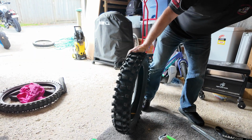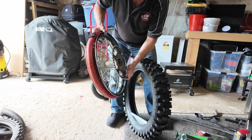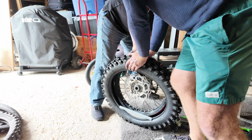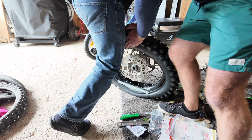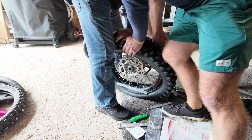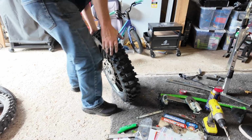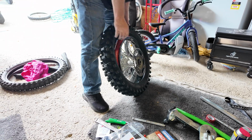You got a metal plate there. Put a little hand here for a second. So what we need to do is press down on there to make the tyre quite oval. And it will spread this. I see. So we're deforming the tyre and really pushing the rim right down inside the tyre. And then we just need to put the bead over on both sides. Yep.